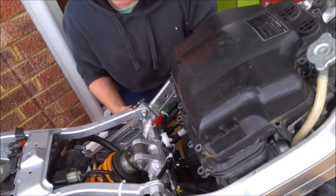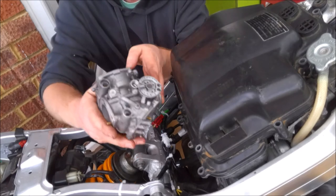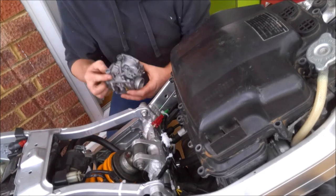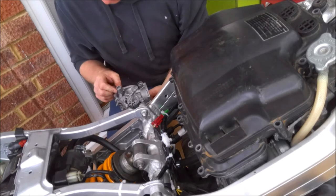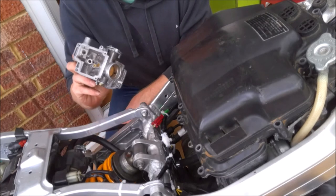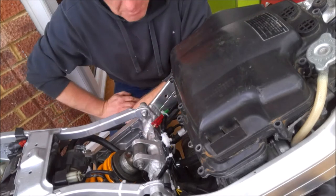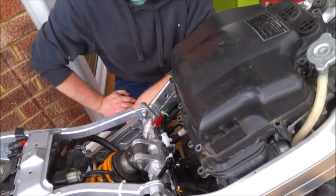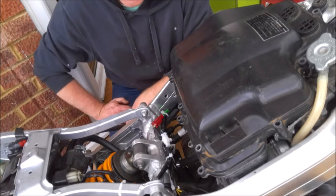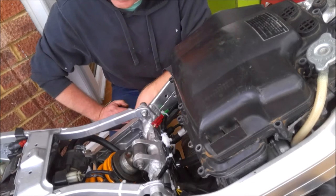That's been one of those things I've gone backwards and forwards on god-knows how many times, taking the carbs off and refitting them. It's purely down to the fact that this carb body was worn, preventing it from sealing properly. The weird thing is, looking at it, you would never ever tell. So yeah, that's destined for the scrap pile - shame really, but there we go. The good news is I had a partial set of carbs to nick the other body off. Now we've done that, I think it's time to properly fit the airbox and move on to fitting the tank and the rest of the fuel lines.